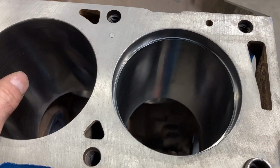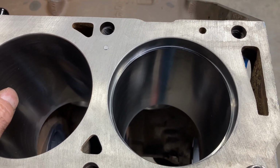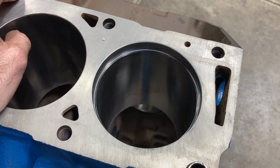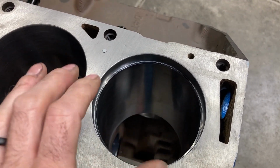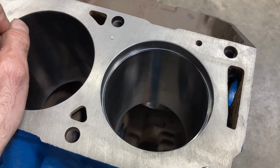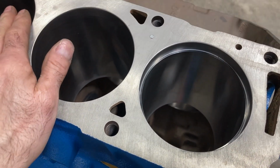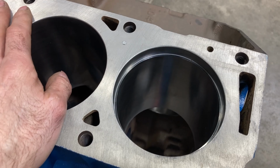So I have put out an email to my contact at Mahle, and I'm going to get another full set of oil rails for this piston. I just don't feel comfortable with what those others were doing. They literally would not stay in the bores at all, and you couldn't even look at them without them falling through. I just don't have any desire to play roulette with that. So that'll set us back several days until I get a full set of oil rails from them.